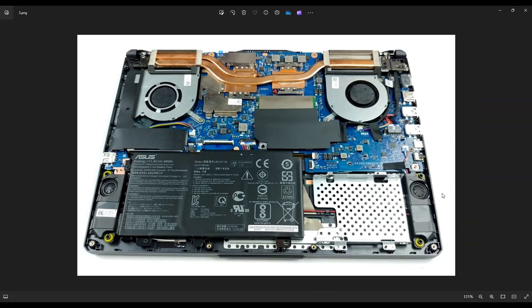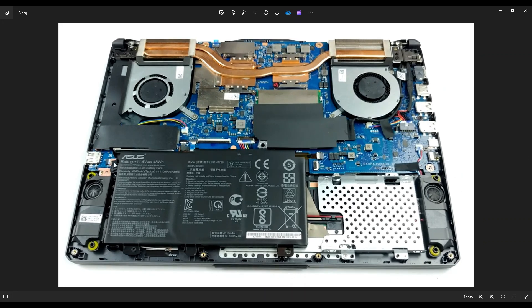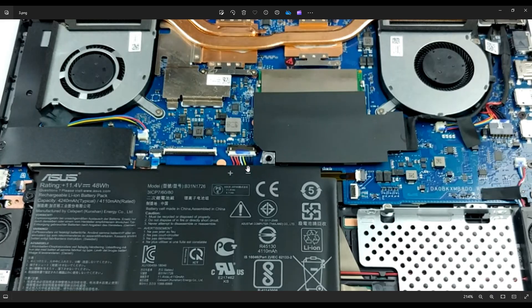As a general rule of thumb, before I do anything inside a computer, I always remove or at least unplug the battery — it makes the computer a little safer to work on. To remove the battery, you have a screw near the left and a screw down here on the bottom near the corner. Your battery plugs into the motherboard right here. I advise you to not pull on wires; instead manipulate the plug itself. Use a small flat plastic pry tool, push on either side, go back and forth until you've wiggled it out without pulling on the wires.